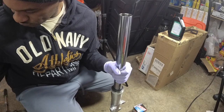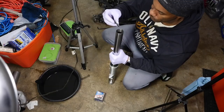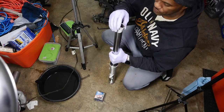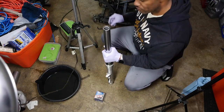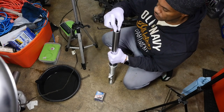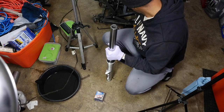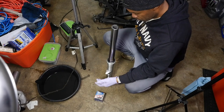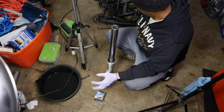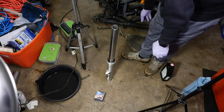All right, so you have your spring, and after that you have one washer that goes in. Then it's your spacer, and then your other washer, which is here, as hopefully you can see, and that's pretty much how I have it. My spacer is approximately 2 5/8. They were recommending 3 inches, but that was just a little too stiff. So right now I'm at 2 5/8, and that has been working pretty good for me.